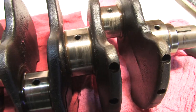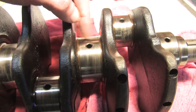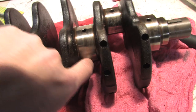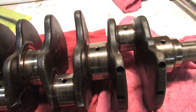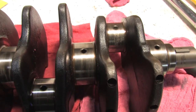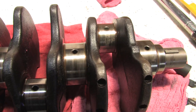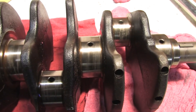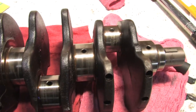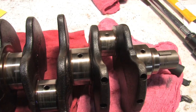If you find any substantial grooves in your crankshaft, it's not a total deal breaker. There's only one place where those should really be and that's where the seals ride. If you find one, it means there's a piece of trash that got trapped in a journal. It's okay as long as it goes in a parallel line all the way around the crank and nothing breaks off center to scrape a bearing down. High spots are worse for your bearings than low spots — it would cut a deep groove in the bearing surface and compromise its strength. If you do have a high spot, something likely got embedded in the crankshaft surface. Usually that can be polished out, but if it's embedded too deep, that one would be junk.